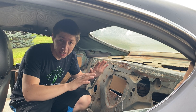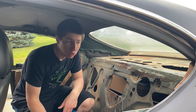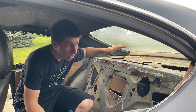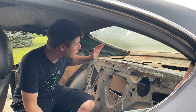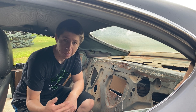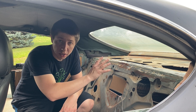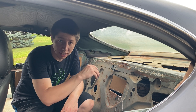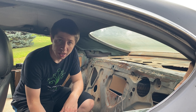We got everything out of the back seat now — got the rear deck lid, all the side panels, armrests, and everything like that. Next I'm going to focus on one part way back in the back that is still green — I want to try to change its color right now. I'm going to sand it down a little bit and then hit it with some rust converter Dupli-Color paint to convert it back to black. I'll have to cover the back window with tape and try to hit it, so let's go ahead and start washing this down, sand it, and paint it black.